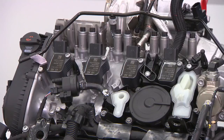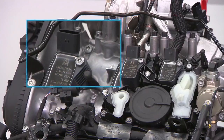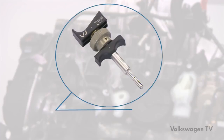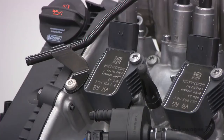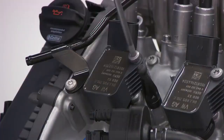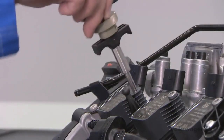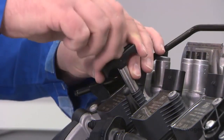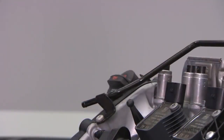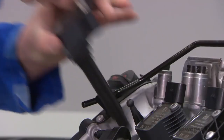In the 2.0-litre TSI engine, pencil ignition coils are installed. If you have to remove these coils, use the obligatory T10-530 tool. First unscrew the securing bolt on the ignition coil. Insert the T10-530 tool into the hole and tighten it with the clamping nut. Now you can pull out the ignition coil — move it straight and slightly support it with your hand. This way you prevent the ignition coil from getting damaged while pulling it out.